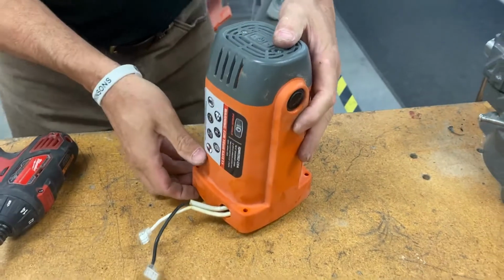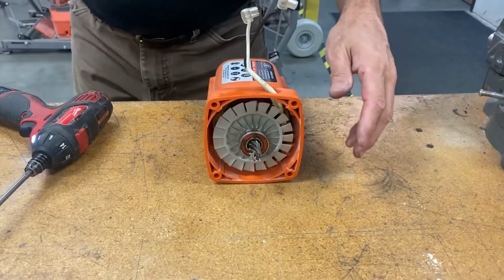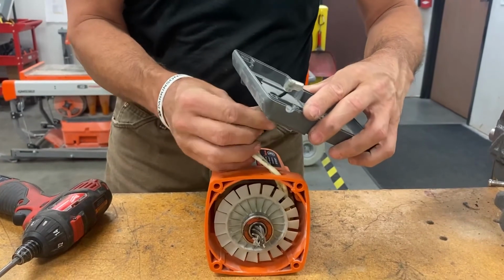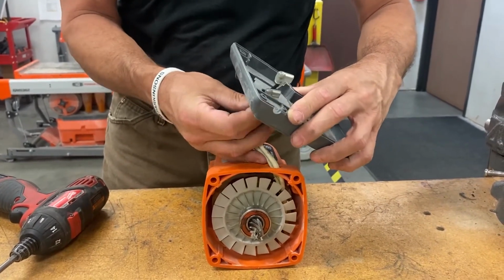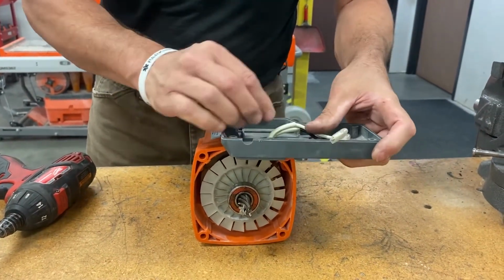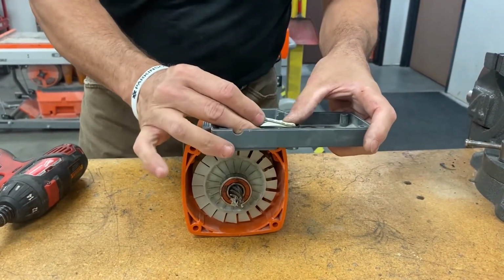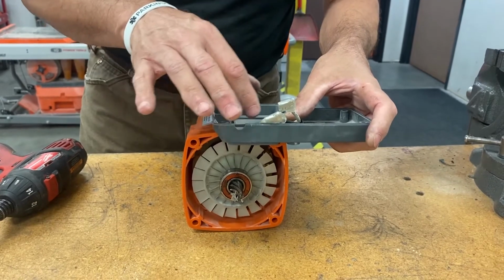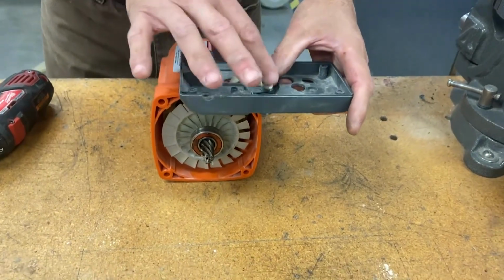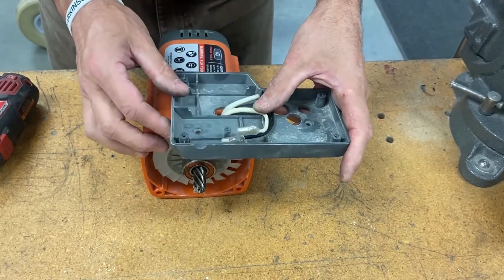Okay. That being said, this would be in the gear housing. You would then route the wire through the base of the control module, like so. Make sure that it's routed to the rear. Place the PCB, connect all the wires. Make sure that the base of the control module is first secured using the 3 screws before you put the PCB in place. And then connect all your wiring and you should be good to go.